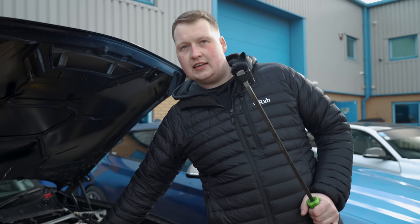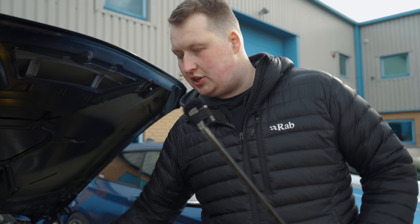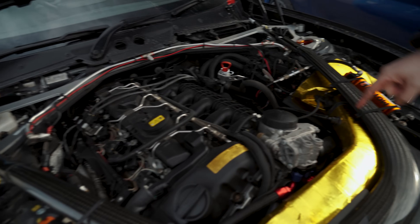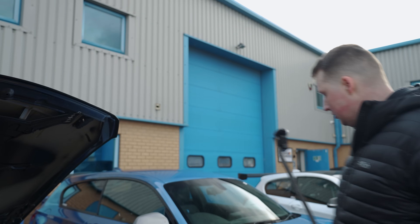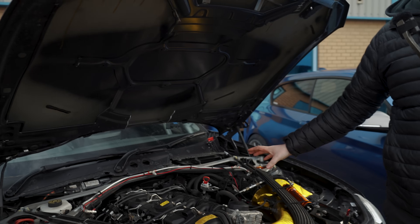People say M-light, not M car — but this has a genuine M car engine. It's N55 B30 T0, out of an M2. The engine code is etched on it if anyone wants to verify. Crucially, it was chosen because it has the S55-style baffled sump system fitted from the factory — as opposed to Jay's car which needed the MMR aftermarket sump baffle.